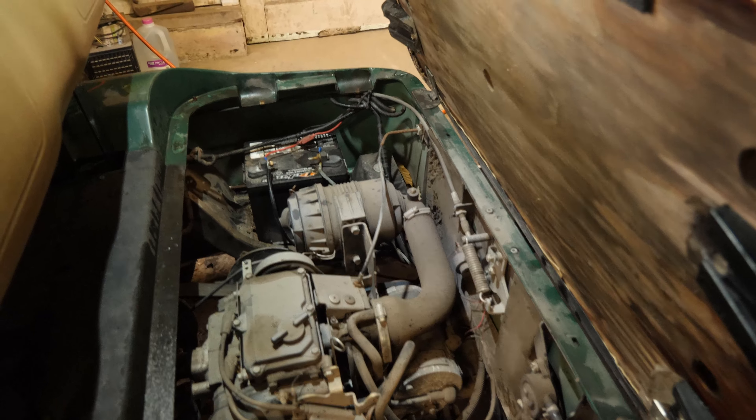Got a new battery - Crown Batteries. This is the brand of battery that I exclusively use across the board. Notice this one here has different terminals. This will actually get installed like that - our negative will be on the same side, positive on the other side. And we're going to replace those nut and bolt type clamps. Those are much more expensive batteries, which is the reason why we didn't use that style and went to this one.